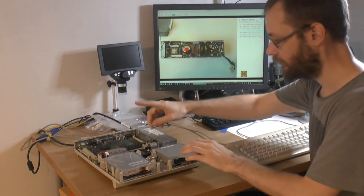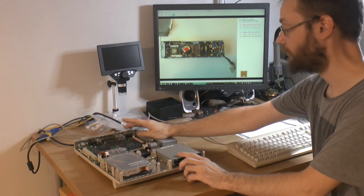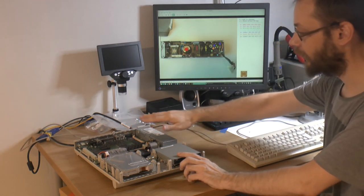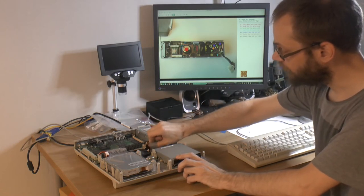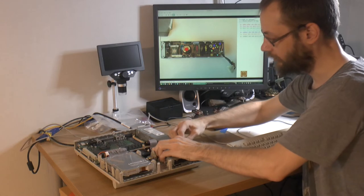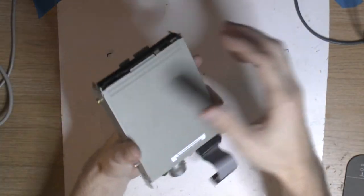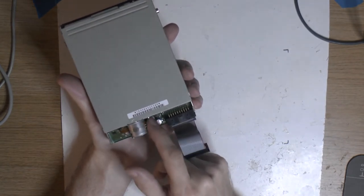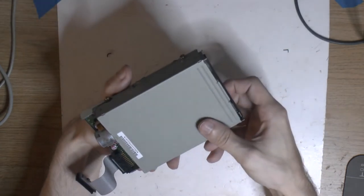The plan for this system is to replace the hard drive with a SCSI-to-SD adapter in the future. I'm also going to recap the motherboard, but I'm not going to do that yet because I have some parts on back order that may come as late as December. I want to put the new caps in last. I didn't make a video about fixing the floppy drive because I figured it was just three caps and wouldn't be much of a problem. The floppy drive has caps here, here and here — two 22uF 16V caps and one 100uF 10V cap.